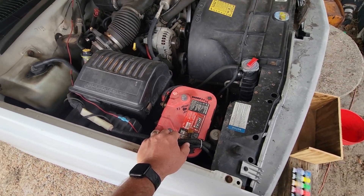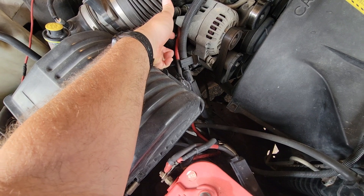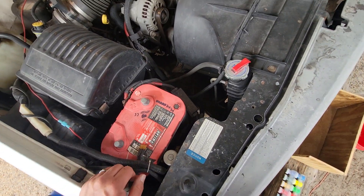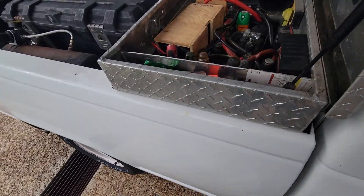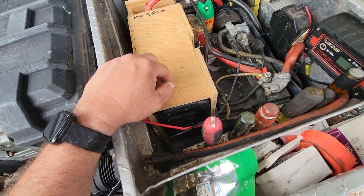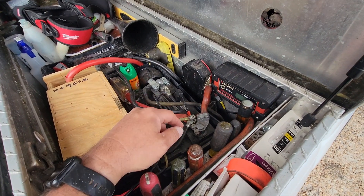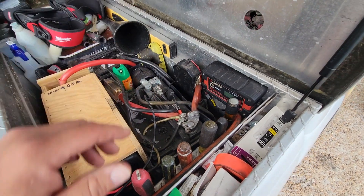My system before the change: I've got a constant duty relay, upgraded my alternator wire to four gauge because the factory wire wasn't up to the task, got some big fuses and heavy cables running back to my house batteries and then under the vehicle on the frame. I've got two batteries, a big 3000 watt inverter with 6000 peak, and this is what's been running my rig daily for years. Most of the charging is done by the truck's alternator. When I come home on weekends I plug it in - I've got two separate chargers, one for the AGMs and one for the starting battery up front.